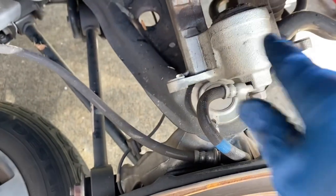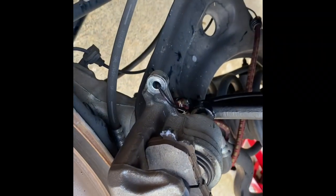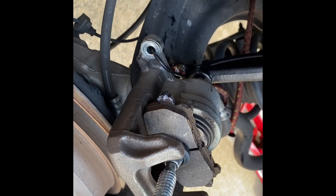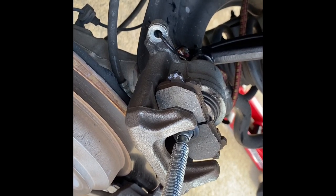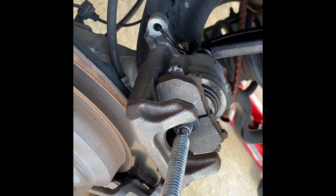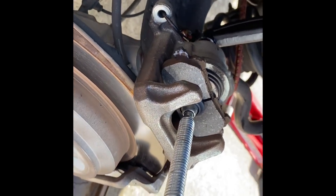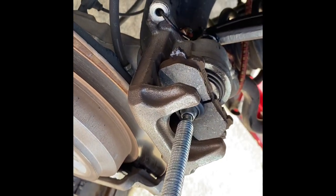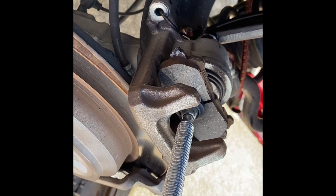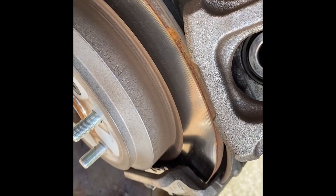Now you're going to have to clean up the caliper a little bit and push the piston back in. I've got this big C-clamp and the old brake pad. You can alternatively get a special brake piston tool. This car doesn't have a special one for the rear brakes — you do them the same as the front brakes. Be mindful and watch the boot — make sure it doesn't look like it's going to tear. If it tears, you've got to buy a whole new caliper and then bleed the entire brake system. Push back the pistons, and now I'm going to put the calipers back on — they go on at about 25 foot-pounds.